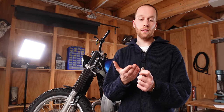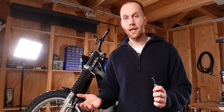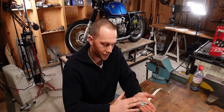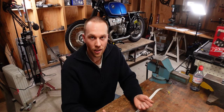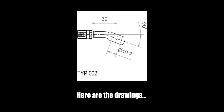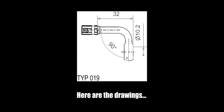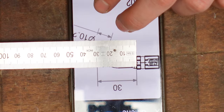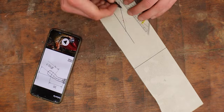The second parameter is the bend angle of the fitting, which was the much harder task for me. If you've never had a banjo fitting in your hand, how are you supposed to know what a 40 degree bend angle looks like and how that influences the rest of the brake line? Here's a trick: make a template for each of the different bend angles. My first ones were horribly off, but then I found a better way — find a technical drawing, I found mine on eBay listings. Screenshot it, make sure you have the measurements on there, then scale the picture until the measurements are correct on your phone screen, and copy them onto cardboard. This gave me much more accurate templates, and I could instantly rule out the 90, 75, and 60 degree bends.